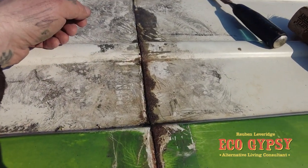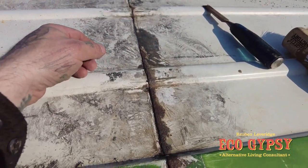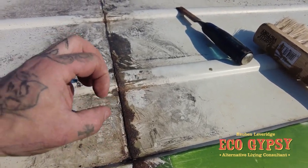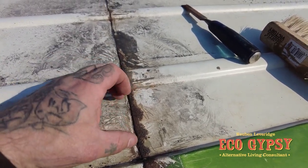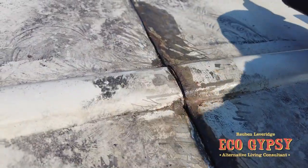Here's a top tip: probably not a good idea to paint bitumen over rusty metal. What's happened is the rust underneath has bubbled up under the bitumen, and the bitumen going over it is just holding water underneath. So what we've done is scraped all this out.